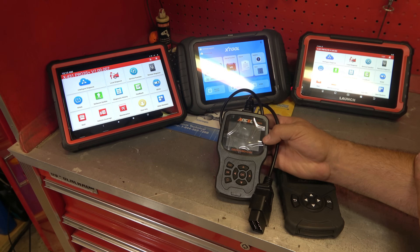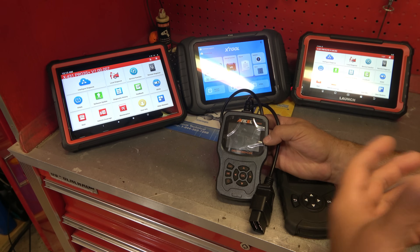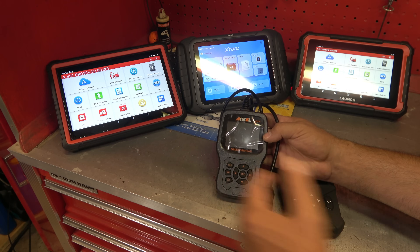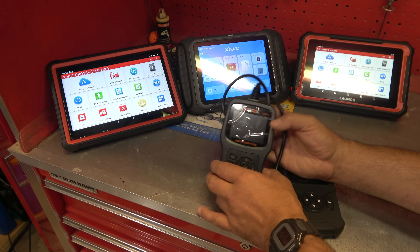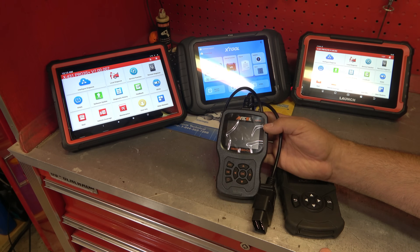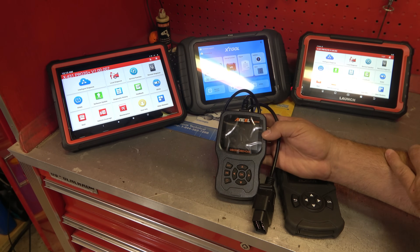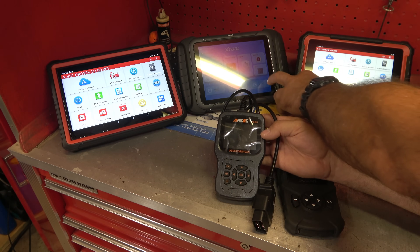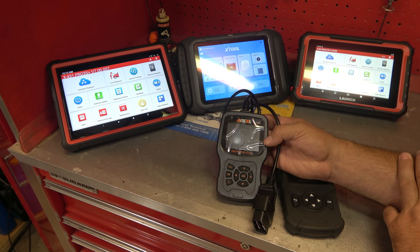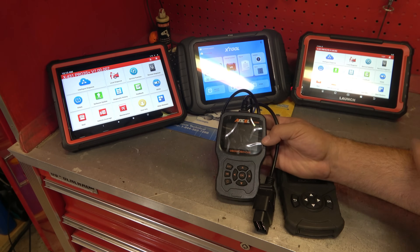What can this not do? Lots. There is no programming that can be done with this tool. It also won't get into your subsystems like climate control units, cruise controls, seat controls, door controls — things like that. You're not going to be able to do any kind of bi-directional controls with something like this. But you're only spending $60 or less, and even most techs who have pro-level tools or OEM software are still going to have something like this, because it's an easy way to run out to a customer's car, pull a code, and show them what's going on before doing deeper diagnostics.